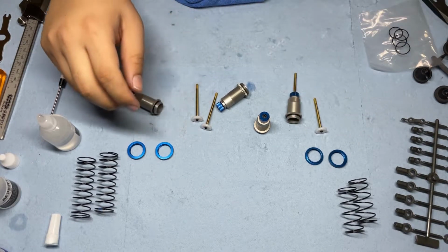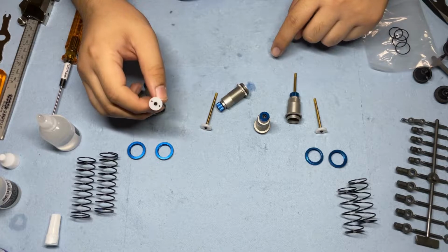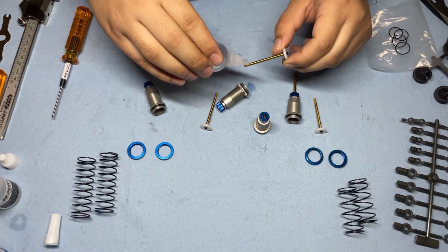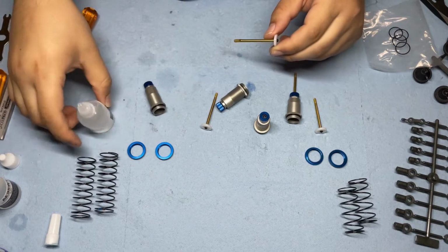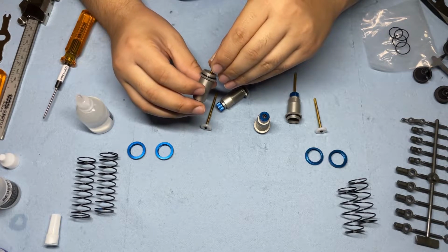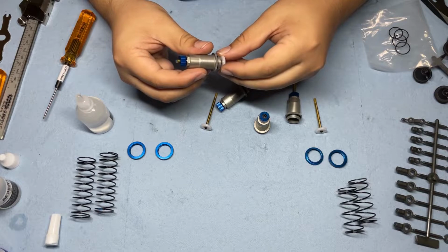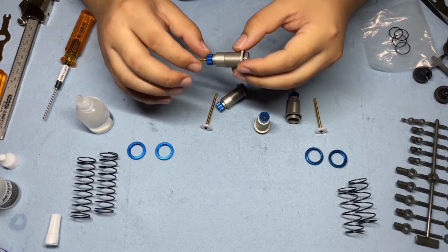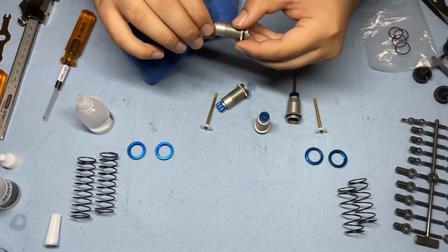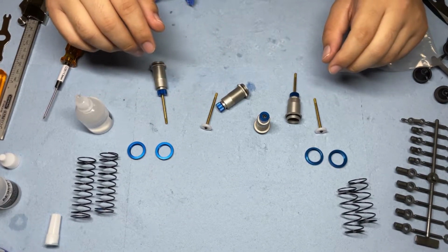All right. And then for the rear, the rear shock does not have any nylon spacers that go in it. So we basically do the same thing for the rear. Just apply a little bit of shock fluid through the threads. Make sure they're nicely covered. When you install, rotate clockwise and slowly push out. And there we go. And then just wipe off any excess and tighten the shock bottom cap. And go ahead and do the other two, and then we can move forward.